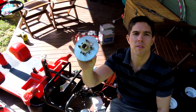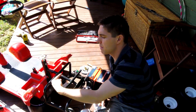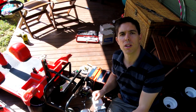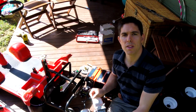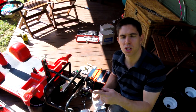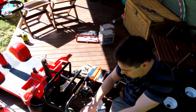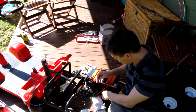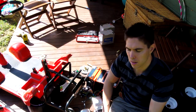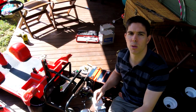The sprocket is on — very happy with that. Next job is to remember which way the motor spins and make sure it's mounted facing the right way, because if we get that wrong it'll spin the axle the wrong way. You might be thinking you can just put it in reverse, but reverse is a lot slower than forward. So what we're going to do is fire up the motor and draw with a sharpie which way it spins — it should be clockwise. That was clockwise for forward; putting it in the other direction was definitely slower and anti-clockwise. So I'm marking clockwise as the forward direction.